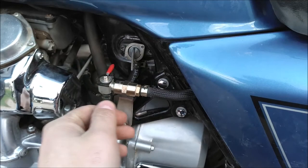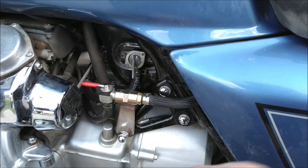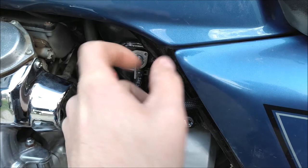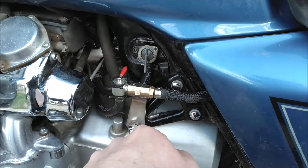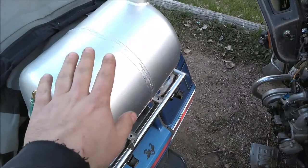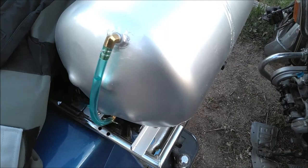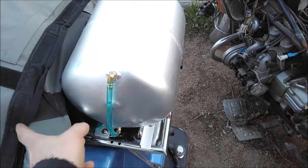Now we just need to take it to the gas station, see how much fuel this holds, add that to the main tank capacity, and figure out the range. Just got back from a 50-mile test ride — I was running off just the aux tank, and if I switch it the other way the aux tank feeds into the main tank, which I don't want right now since the main tank still has a lot of gas. That all works fine. I had it full to the point of brimming over and a little fluid got down the vent line but it came out safely. It filled 3.7 gallons — I'll put a picture up at the end with the math, and you can see the level indication working. Another project completed and successful for a change.